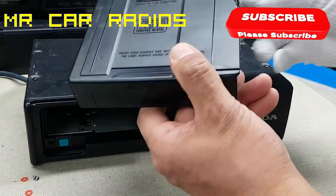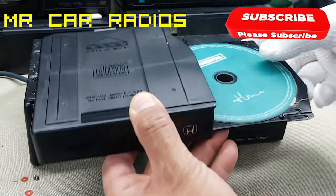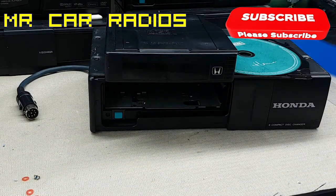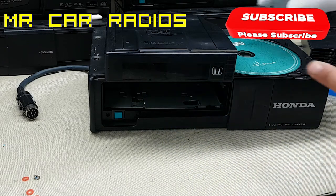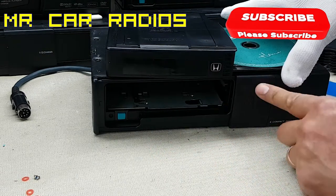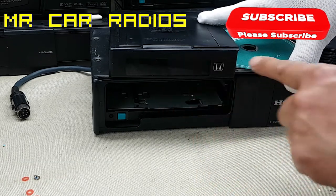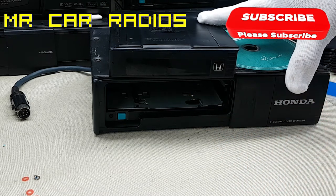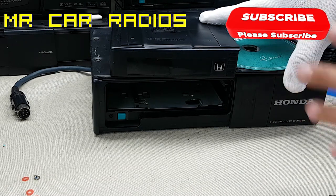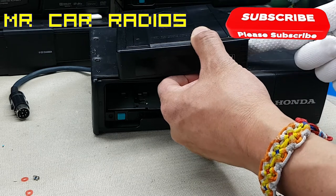Not all magazines will come out this way — some require repair. If you've got a tray with a CD already stuck in play mode sitting inside, and you try to force it out from underneath, it will not come out because the magazine is offset to one side and it will hit the casing. If you manage to get it partially out but it's stuck, you'll need to dismantle the whole unit. You'll have to roll a gear under there until the tray comes all the way back inside, and then try the ejection again.